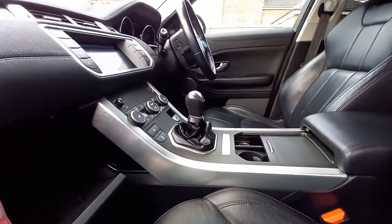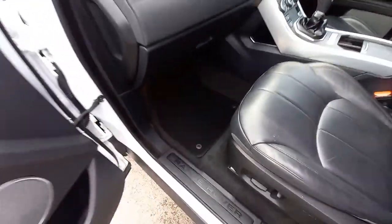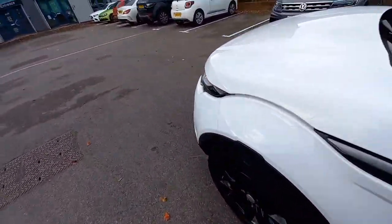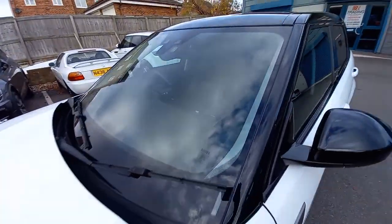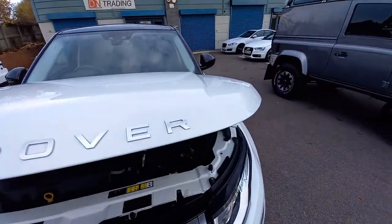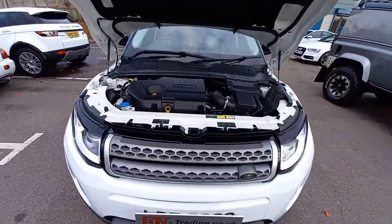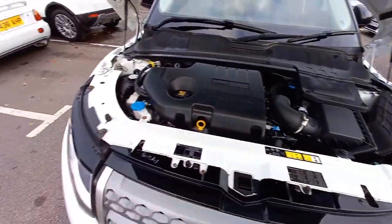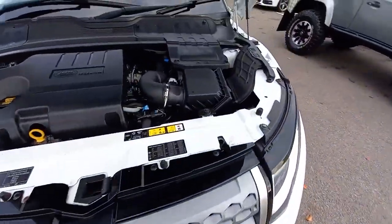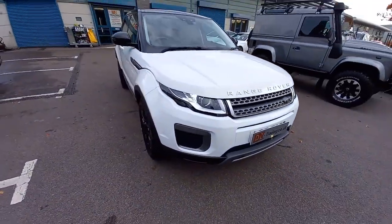The documents are in the glove box. It has service history — there is a very detailed invoiced service for the last service, and we're waiting to have it serviced again with an extended MOT. As of the 29th of November the MOT will be 13 months, because the current MOT expires on the 28th of December — you can have the MOT carried out exactly 30 days before and it will extend to 13 months. Under the bonnet it's very clean, and you can hear the very good engine sound. This is the 2-litre engine, not the older 2.2 — the 2.2s are usually the four-wheel drive ones, so this is the two-wheel drive version.